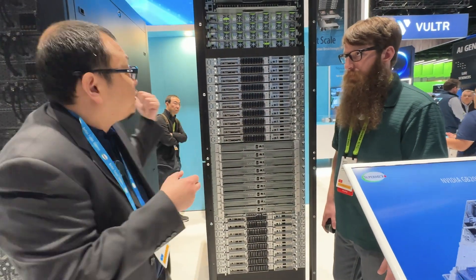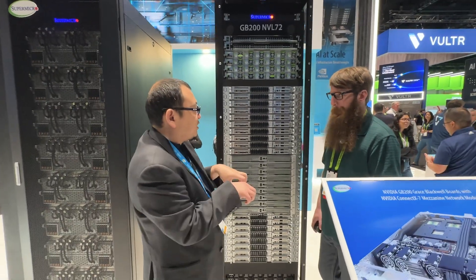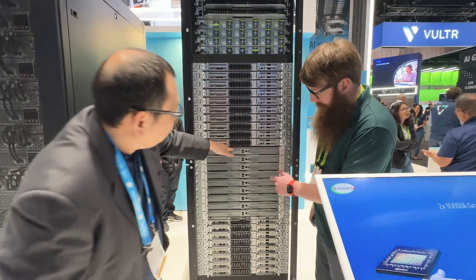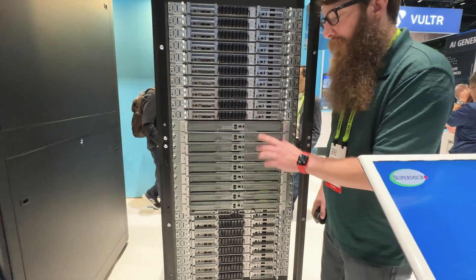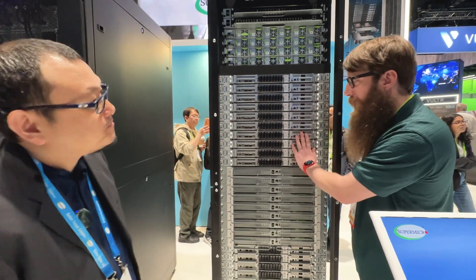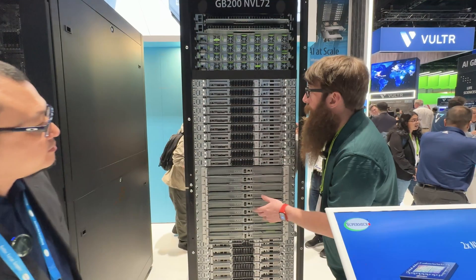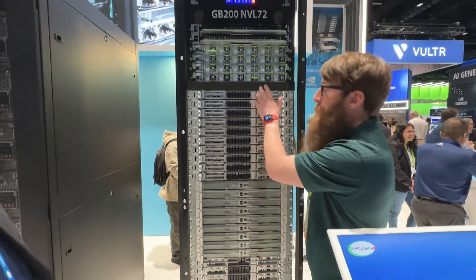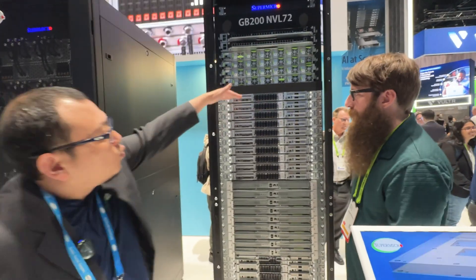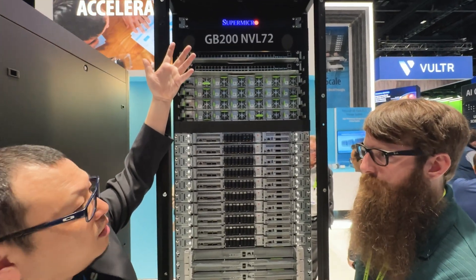What NVL72 means: what you see in the middle here are all the NVLink switches — not the NV switches on the SXM board. You have four NV switches creating the interconnect between the GPUs. In the middle we've got NVLink, and then east-west networking and north-south networking on each side. There are also E1.S drives in the middle. Powering all this, there's a massive bank of power supplies up top. This thing has 72 Blackwell GPUs in it.